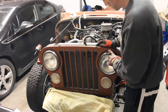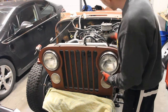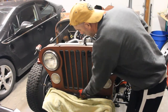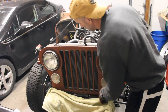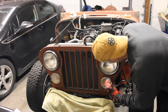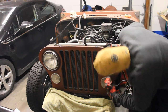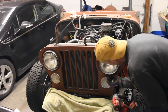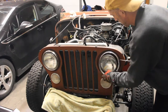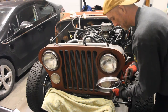Next thing, let's take off the grill. I think we need to do the light housings first so that we can unhook the wiring. And then at that point I think it's just the grill supports, and maybe one body mount underneath here. I already know that this thing's rusted out and it's a complete catastrophe, but it would be fun to see what happens. From what I can tell, there's one screw at the bottom and then two adjustment screws up top. Take this one off here first — small little screw. Once you get that lower screw out, just take a screwdriver and slowly pop it out. The thing comes right off. The tongue goes into the groove up here and it's just held in by that lower screw.